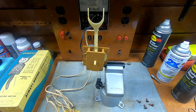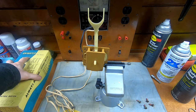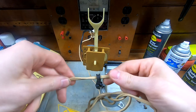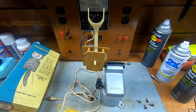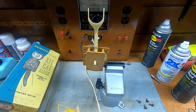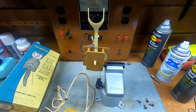We will get the body of the clock ready and put that back in since I got the painting done on the other parts. There is one little thing I wanted to deal with before we do that however - the grommet that went on the original power cable is hard as a rock. I'm going to undo the nuts, take the cord off, and see if I have in my assortment here a reasonably correct sized grommet. This diameter is a little small - let's go up a size. Yeah, that's more appropriate, I think it's a 3/8 with a 244 thousandth inch internal diameter.